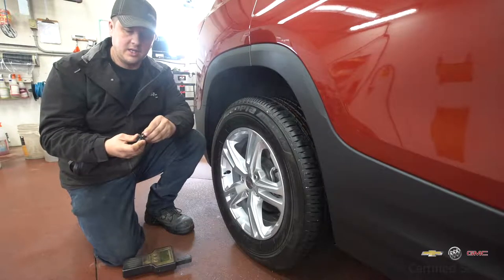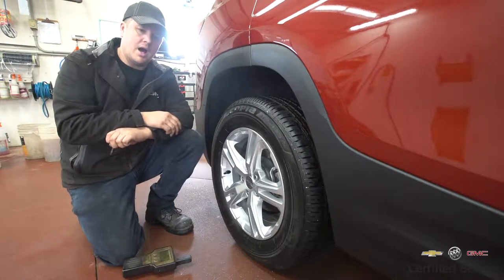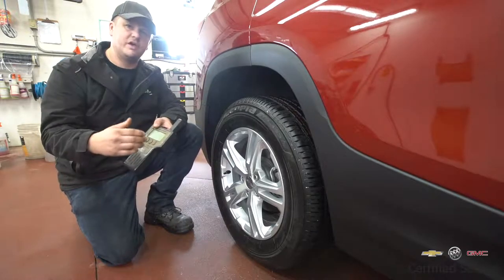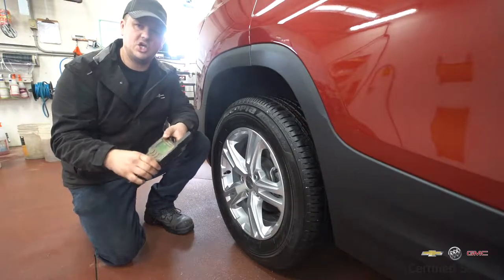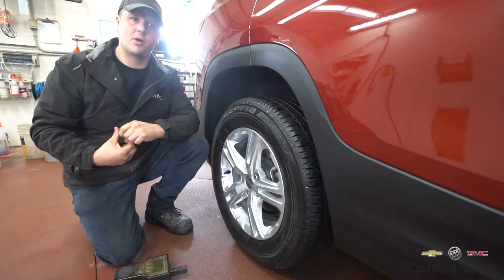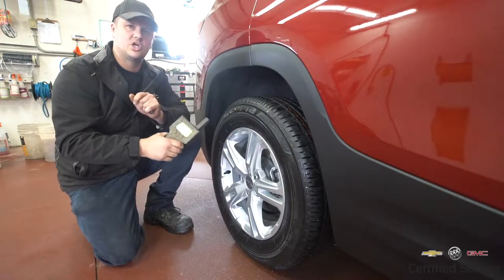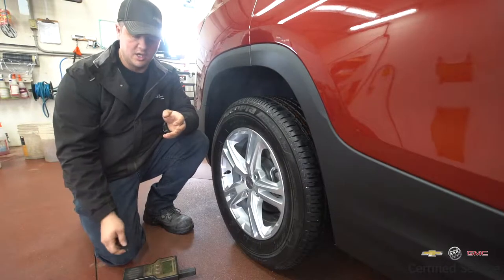One thing to keep in mind: if you're driving a vehicle that displays the pressure in each tire, some manufacturers' systems can learn the tire positions just by driving. Other manufacturers, including GM, require the sensors to be relearned — that's what this tool here is for. So when you bring your vehicle in and we're doing a tire rotation, or if a tire rotation is done at home or at another shop, if they don't relearn the position of each sensor, it may display incorrect information. It might show a right rear tire that's down three pounds, you fill it up, and it's still showing low — because it might actually be a different tire. This machine puts it in learn mode and we select each tire to indicate its location. So every time you have your tires rotated or swap your winters to summers, this should always be performed.